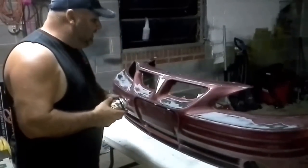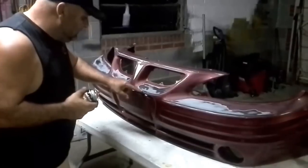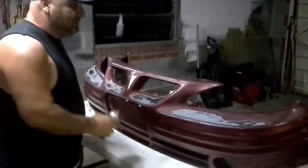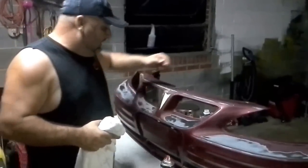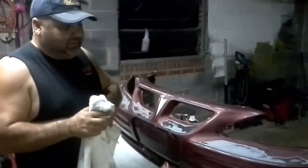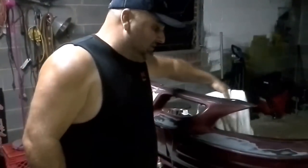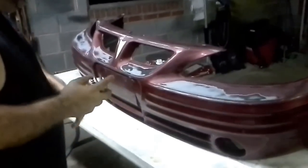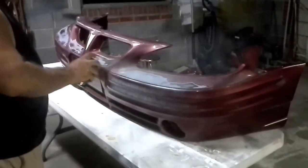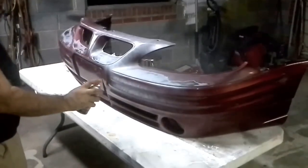Alright, my girl's got this thing ready to rock and roll. Got a couple little water drops here — let me take care of those. We're making sure there's no water. It's been wiped with acetone, or you can get a paint prep product, anything you want. But whatever you do, put something on it to make sure nothing's going to keep this stuff from adhering. The first step with any kind of paint job or home project like this, you can use the Duplicolor Perfect Match scratch filler. It's going to take care of a lot of your issues. The first thing you do is just a dust coat — you're going to see how well it's going to try to stick, and you're kind of looking for fish eyes, spots where it just doesn't want to stick.